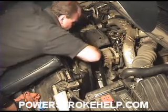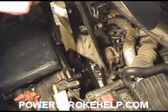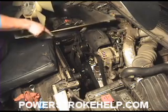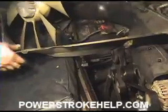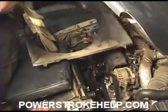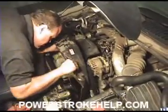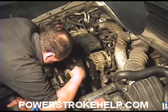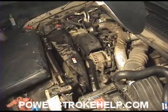The lower part of the fan shroud has two little nubs right here on each side. This is where your lower radiator hose goes — you can actually rest it on there. But you've got to make sure that these little nubs, these tabs, are stuck in the bottom of the little clip down there in the bottom of the radiator. You've got to make sure it's in there correctly — you don't want it flapping back when you're going down the road. Take the two of them, slide it down in there, aiming for those tabs. You can put your eyeballs right here and see where it's got to go. Once you've got it in both sides correctly, let the fan rest back against the motor.